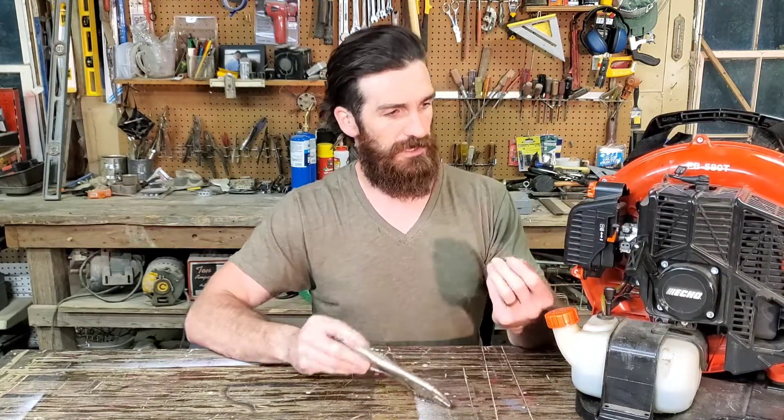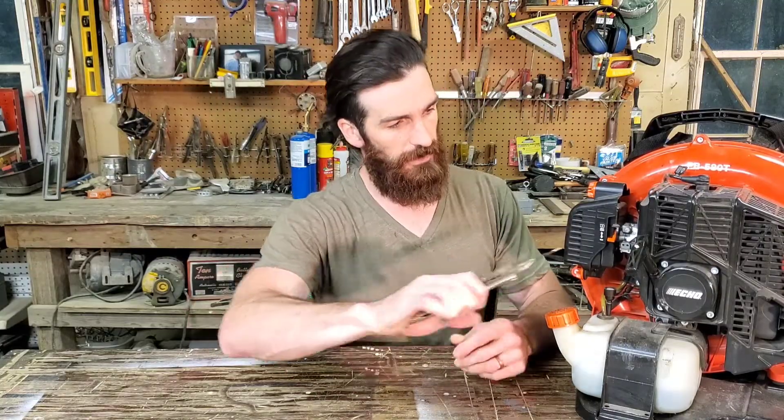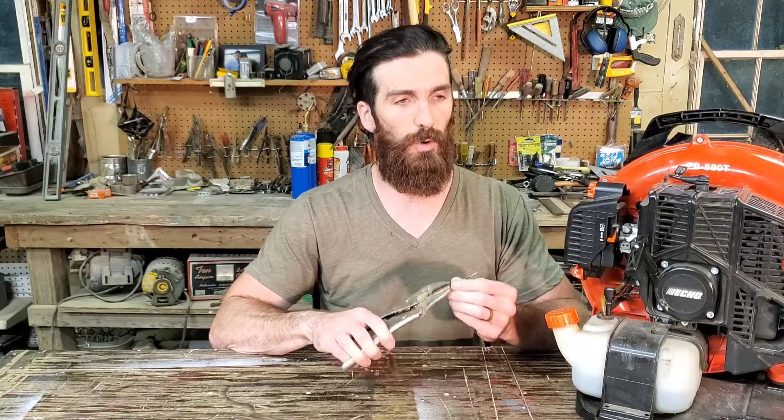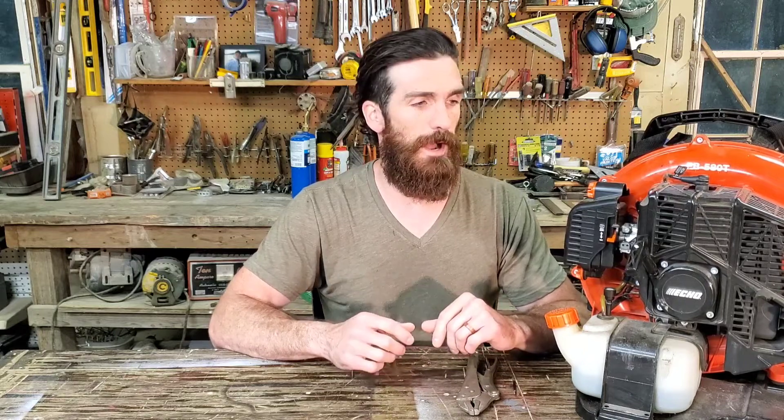I didn't put a handle on this one. For this situation I just used a vice grip, gripped it on there really good, and made the adjustments in quarter-turn increments. I made one quarter turn, fired it up, and it started to get a little more power. I ended up doing one and a half turns total and now it has a smooth idle all the way up into high power because it's getting the fuel it needs.